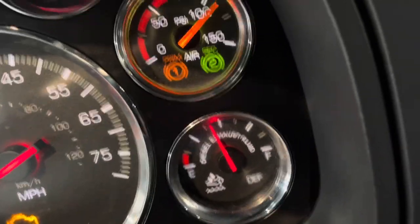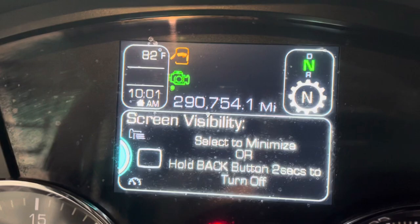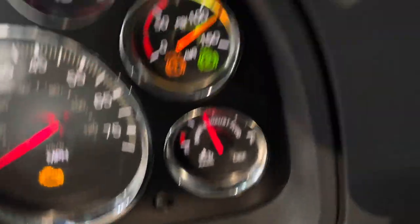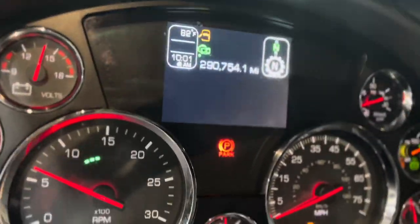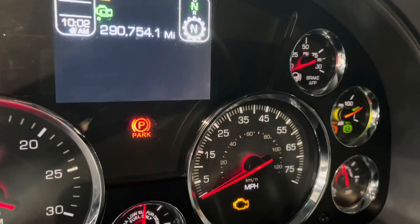Let it go down a little bit — this one might not need to, it's still up there. As you can see, my DEF gauge is now reading, and I haven't even cleared the code yet, and my message of limp mode is gone already. So that's how you know — definitely that was the level sensor that was bad. I'm gonna get on here, clear the code, show you what code was on there, and then we'll be doing a regen. A regen is always good to do after doing a job like this.